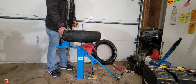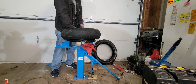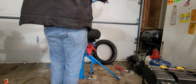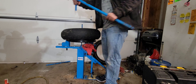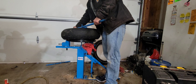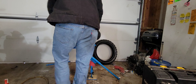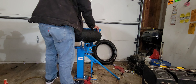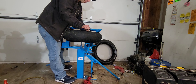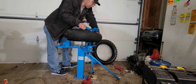I've got our yellow bead keeper. We go back with our Nomar handle. This has two knobs on it and they just both set down between the bead of the tire and the wheel. I just roll it on, but we get to a point where we start to get a little bit of resistance and then we've got to watch for the back side of the tire, lift it up, and keep it in what a lot of people would call the drop center. We push the top down into the drop center.